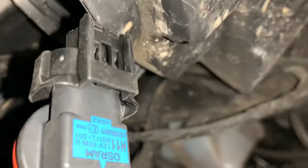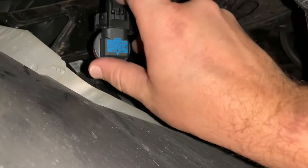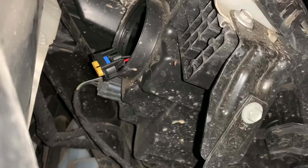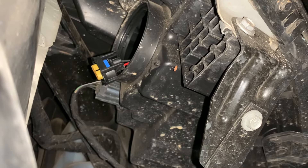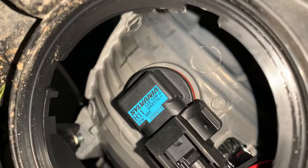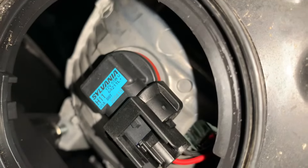There's a little tab on the back of the light, and you're going to have to pry it up in order to get that old light out. Sorry for the crazy camera work — you're going to have to pull this little tab back, and the light should slide right out. Sorry I couldn't show you me pulling that out, but I just could not get the camera in there. As you can see, the light bulb is gone. We're going to snap the other one in, and then do that quarter turn clockwise — to the right — to put the bulb back where it goes. The new bulb is in place. We're going to put the cover back on the access port, put the screws back in place, and then test it out.